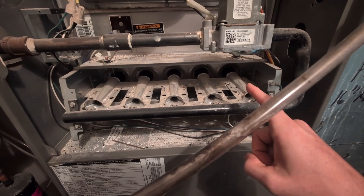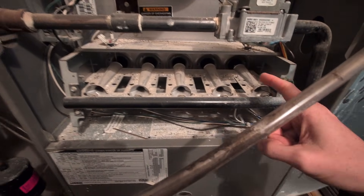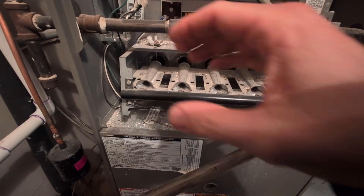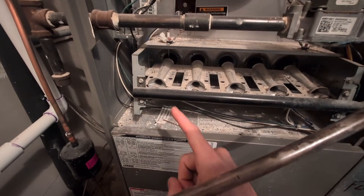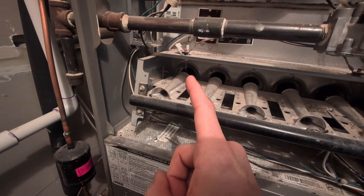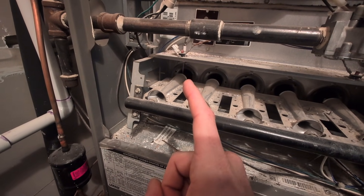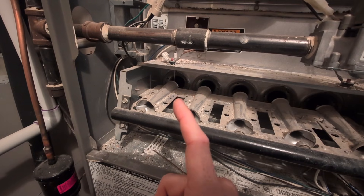It'll light up kind of bright orange. Then the gas valve will open and release the gas that sprays across one, two, three, four, five burners. In this case, it'll just go flame, flame, flame, flame, flame. So at the end here, this last one will come on. And if you look down in there, that's the issue — that's what's called a flame sensor, and that senses, as you would imagine, the flame coming out of that last burner.